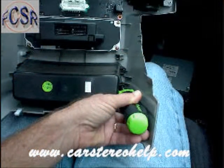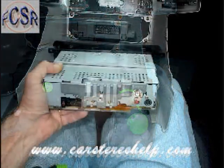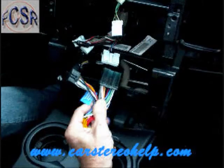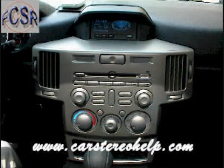Now we're going to take the front panel that we removed earlier. At the back of it, remove the four screws securing the pocket below the AC controls. We're going to use the same screws and bolt the car stereo and kit into this pocket. Take the wire harness and mate it to the factory harness from the original stereo, and route it down below the dash along with the antenna. Put the upper dash back together and place the panel in place after connecting the stereo antenna. Please subscribe and thank you for watching.